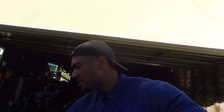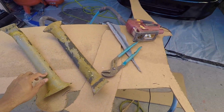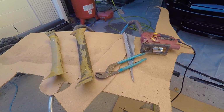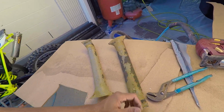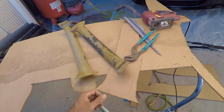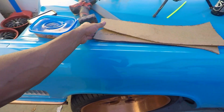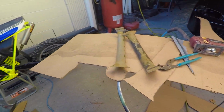All right, y'all, so I just finished taking all the vinyl off the other pieces. This is what they looking like. Let me flip the camera around for y'all. So in order to get these to the level where I can paint it, I'm gonna have to take the sander and sand this with a low grit of sandpaper, probably like 60 grit, something like that. Get it as smooth as possible, and then spray it. I'm also gonna sand up the edges on these other pieces that I cut out right here to get those smooth, and we'll be ready to paint.